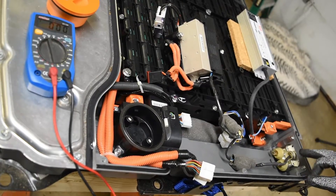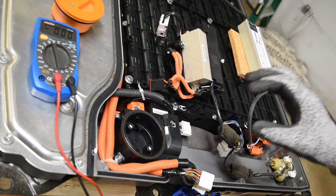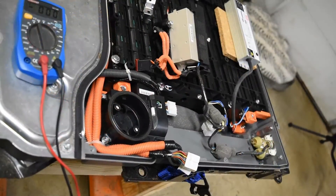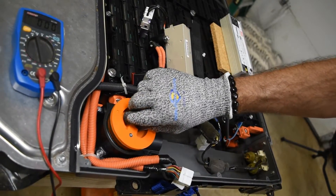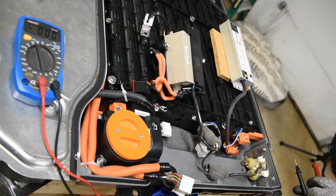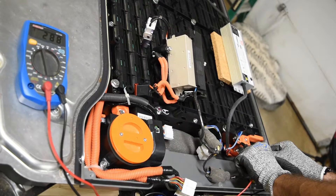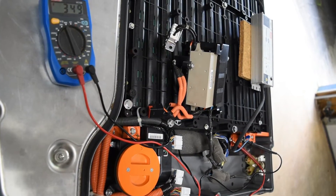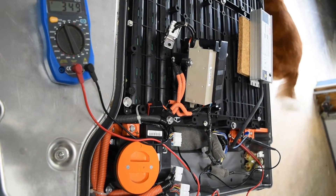With the charger attached to the leads — the plus side is on the bottom, the minus side is on the top — we should have no voltage right now because the safety switch is not installed. Quick check: no voltage. The next step is to install the safety switch. By turning it on, we should now have voltage on those two leads. And as you can see, we have 288 volts — both packs connected. After about six hours of charging, we have reached 350 volts here. That means we're going to disconnect the charger and reassemble everything, then put the battery back into the Escape.